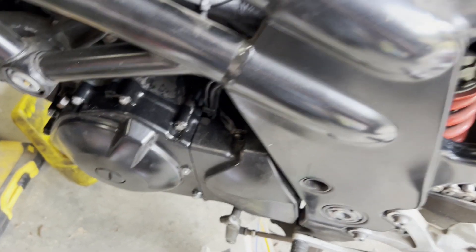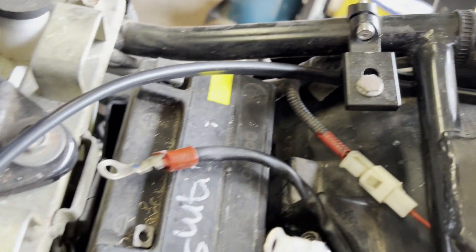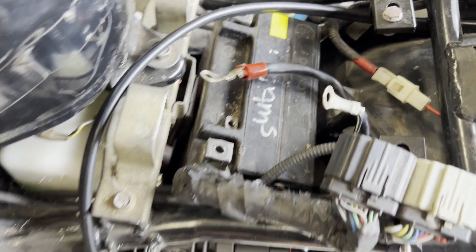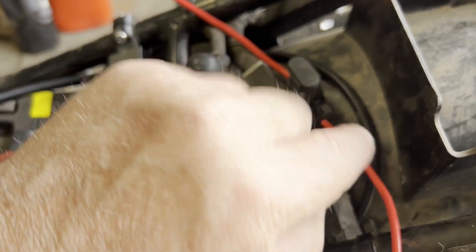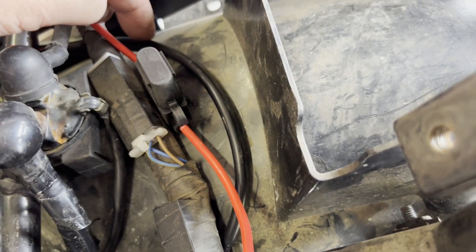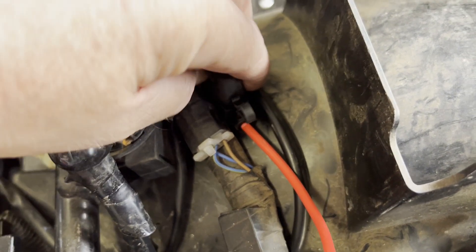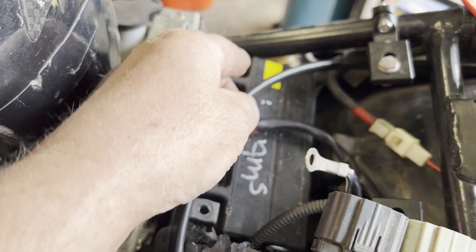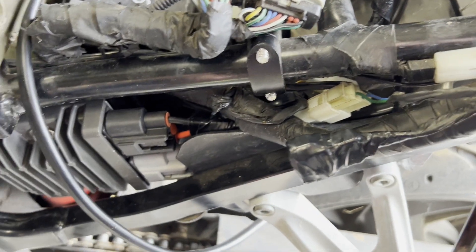From the stator, those wires will loop around and come across — one on the positive, one on the negative. I'm going to zip-tie the new cable to the existing loom, peel out and chop off a section of the red positive lead, splice that into line, and run it around keeping the original sheath. Open the sheath, drop out the positive, bring the negative across — that's our 30-amp lead and our system complete.